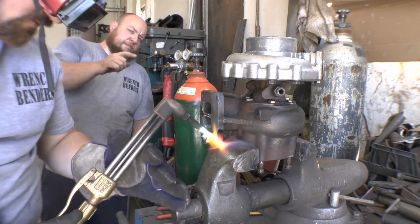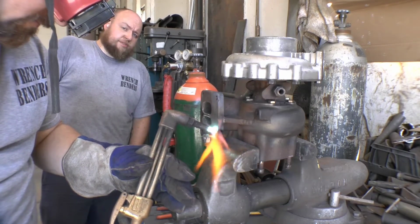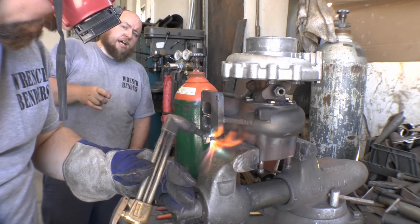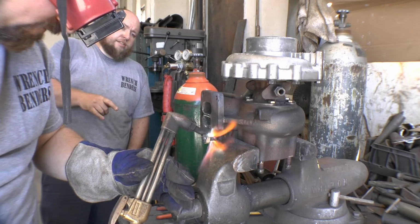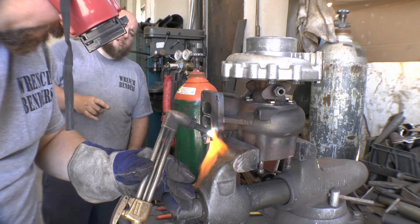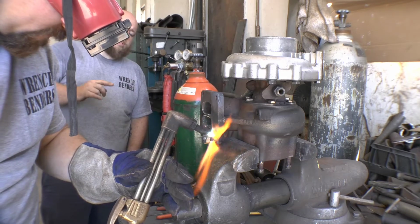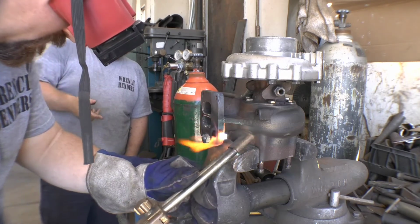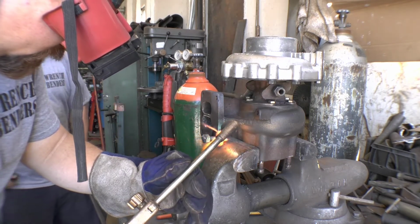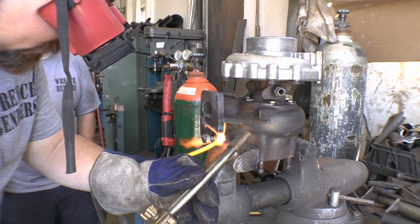Also, key point, if you are heating studs for removal or bolts and you're trying to get anything out, do not, after you apply heat, apply lubricant or cool it down. What you do is you quench it, you harden the metal, and then it'll end up shattering. It'll also become too hard and it'll make it more difficult to drill out. You'll go through more bits that way, if that's your last resort. I'm hoping that does not become the last resort on this. And don't quench it.